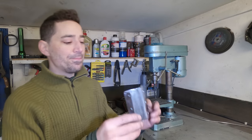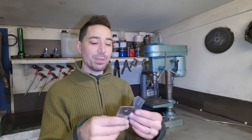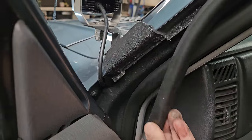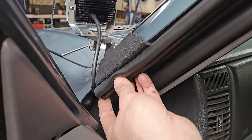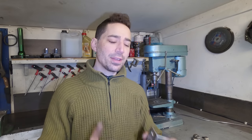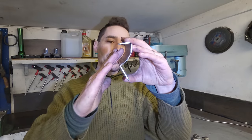I've been meaning to make one of these for about a year and a half. I never really wanted to make one that just sort of screwed into the side of the sheet metal. I've kind of built a wrap-around thing, a little bit like those light pods I've got just in front of the mirrors. But those light pod ones aren't actually that great because they hug the pillar, so you get a slight vibration and it takes the paint away. I've had to pack thin rubber underneath those, which solved the problem. But with this one, I've just made it so there's a gap, so the soapy water can wash the dirt away and it never makes contact with the pillar.